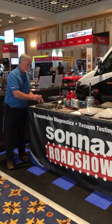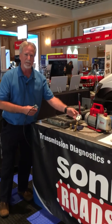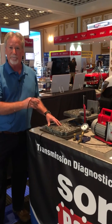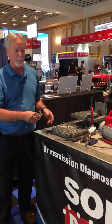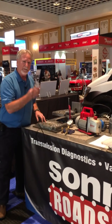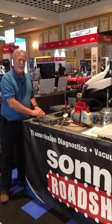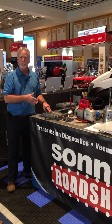Many years back, we introduced vacuum testing for valve bodies. What this allowed us to do is to actually put a numerical number on every single valve so we can actually determine how big a leak was, as well as how to assure that it was fixed when we're done. The testing required that you did an individual test plate to go around the valve body. It takes a little bit of time and a little bit of skill level as you start to learn these processes.